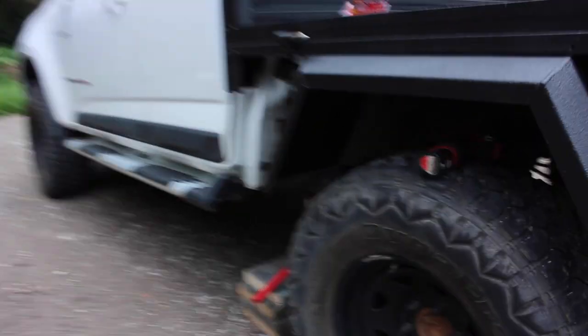So now that you know those rails, all I done was I marked up and pre-drilled some holes when I first mounted it up. So now all I'm doing is putting some tech screws up into my pre-drilled holes. So there's holes all the way along. I'm only going to put the edges in because if it ever rattles and comes loose, then I've got some other ones that aren't worn out and I can drill it into them. Plus that's solid as, and it's only got 8 screws into it. So this is how I mounted it up.